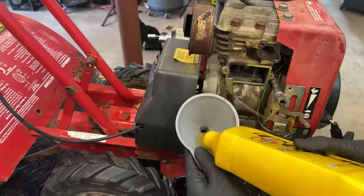It's coming out faster than I thought because a metal bushing fell out when I tipped it over, so that hopefully goes back in. Anyway, it's going to make quick work of getting the gear oil out. And I also drained most of the fuel and pulled the oil from the engine as well. And it's surprisingly dark, considering this was only run, I'd say, for maybe 5-10 minutes while testing it. So I'd say there is a lot of sludge in there, for sure. So changing the oils out again, I would say it was needed in this case.